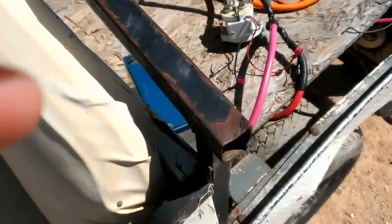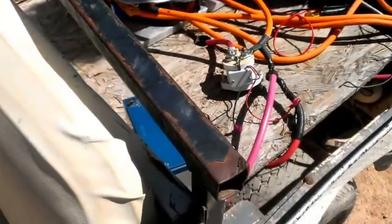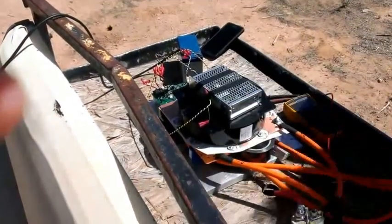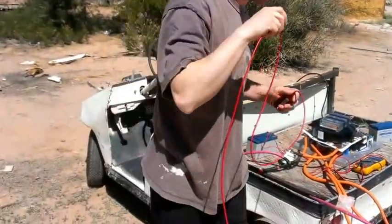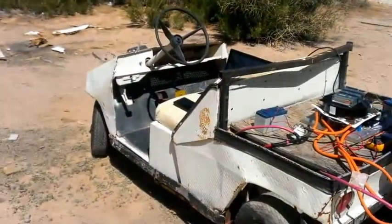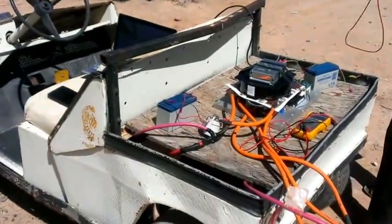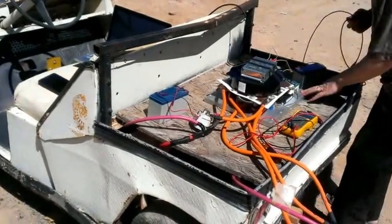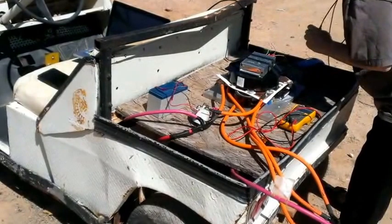There wasn't even a spark. That's kind of boring. 24 volts — you know what you're going to do. So we need to bring a laptop out and program production, and then we're ready to go. I'm pretty confident that the reason I welded the one contactor was because I didn't disconnect the high voltage pack.